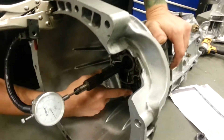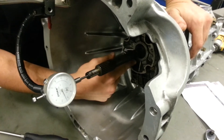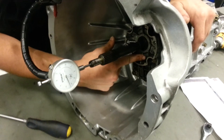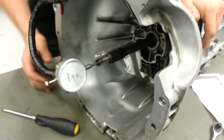As you can see, we don't have any here. What we're going to have to do is go into this plate here, and right around this inner ring here is going to be a set of shims or a single shim. In the case of it being a single shim, we're going to take it out and replace it with multiple smaller shims in order to get it back to manufacturer specification. So that is end play on the input shaft of a manual transmission.